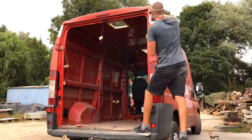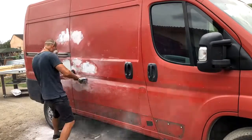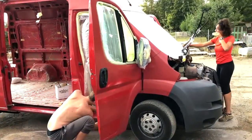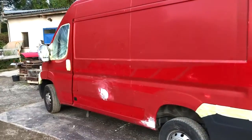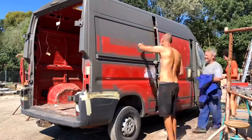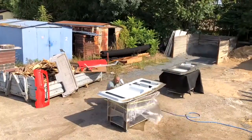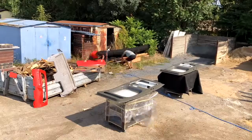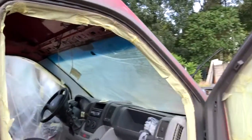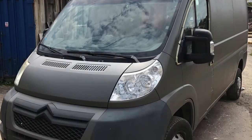This I believe is skippable for most people — it's a paint job. First I did some body filler to fix imperfections. Second, I ran around the car with fine sandpaper and sanded down loose paint and rust. Third, I washed and degreased the entire surface. I decided to just roll the paint on our van — it's the cheapest and fastest possible way. I spray painted all curves first so you don't see brush strokes, then did two coats. The result is pretty good and I don't stress about scratching the car at all. If I do, I can anytime do another coat for a few dollars.